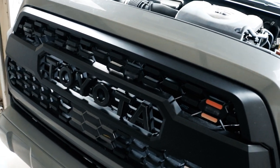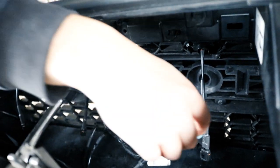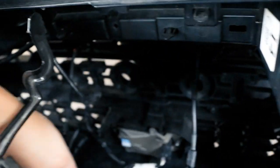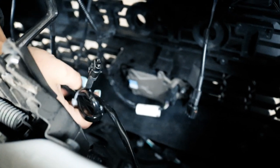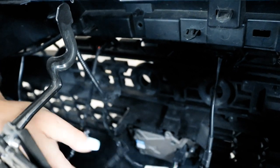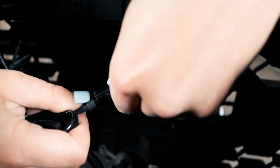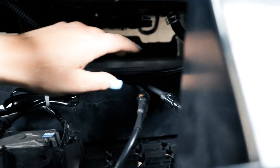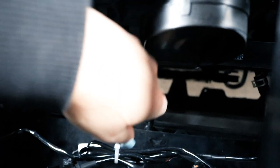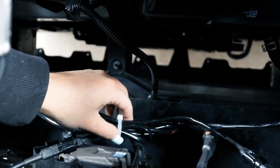I'll turn the lights on so you can see them once I plug everything back together. All the lights inside the grille are set — all I have to do now is snap these connectors to the zip-tied harness that's already in here. These plugs go straight to the lights and then hook up into the fuse box. All four lights are plugged in to the harness. I zip-tied things to clean it up a bit — you could probably do more to hide the wires, but this is good enough for me.